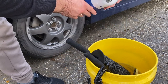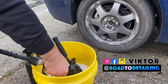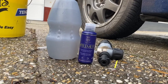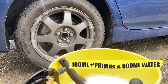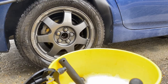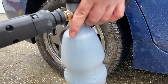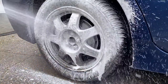Starting with the wheels, I splash a bit of Surfax HD in a bucket of water, which usually gives me more suds, lubricity and cleaning power. Obviously a bucket of clean water should be enough here, but I like to have it this way. The main chemical I am using today is Labo Cosmetica Primus — a multi-purpose foam pre-wash diluted 1 to 10 in the first generation MTM Hydro PF22 foam cannon. I wanted to use something versatile enough to use on the wheels as well as for pre-wash on the bodywork.